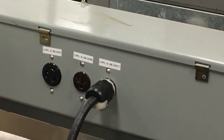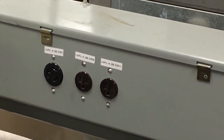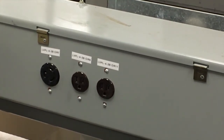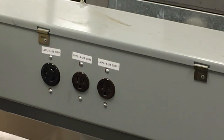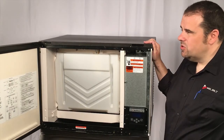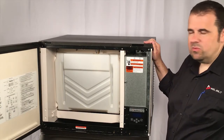We've got to pull that plug out from the outlet and disconnect it. Now if it's hardwired in, you're going to need to find a circuit breaker or a disconnect, and if you turn the circuit breaker off, make sure you lock out or tag out that circuit breaker. The next thing we're going to do is remove the panels on the machine so we can access it to install that Luminize Kit.